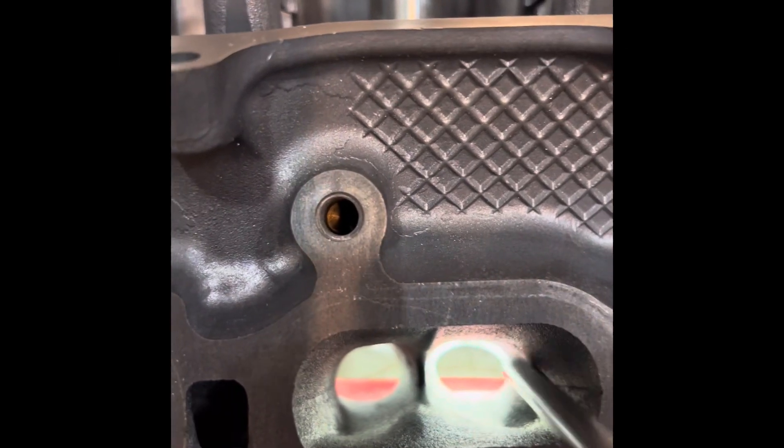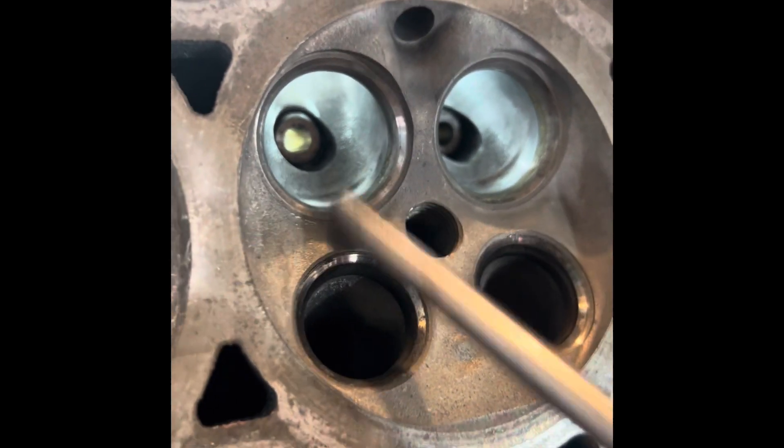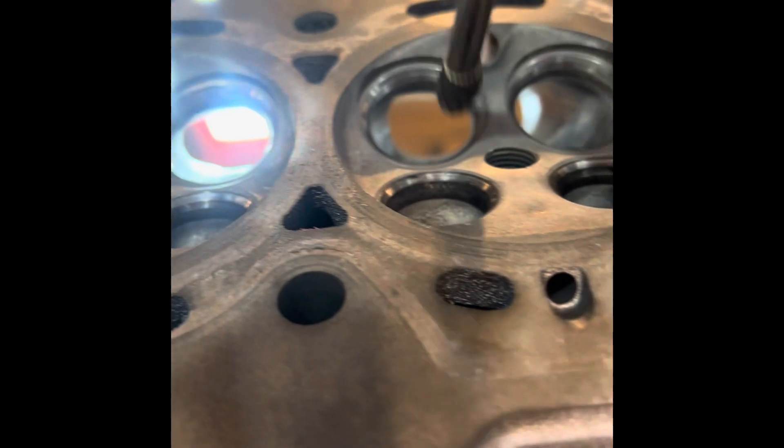Ported on the intake side from the inlet, going through to the non-ported side. This is interesting because the way they do this on the Type R - this lip right here is normally filled in so you have a straight shot, but there's a lot of material. They actually pinched it by literally creating a vortex, so I have to be really careful in how I ported and designed this port. It doesn't look that much bigger from this side, but there are significant changes to the shape of the port and how it all runs through. I'll show you what I call the flame test after this.